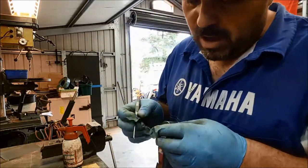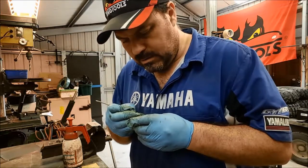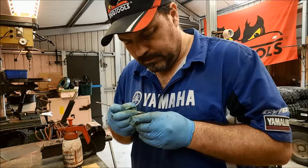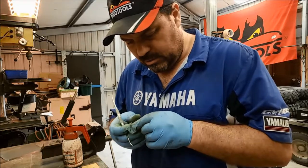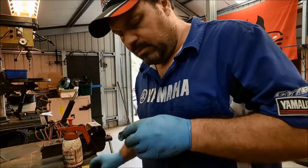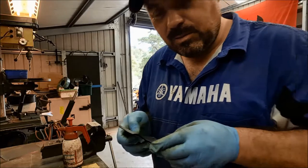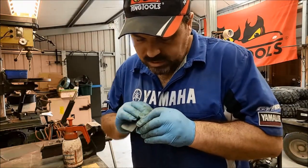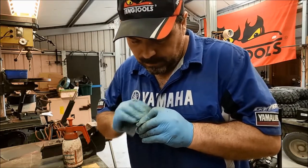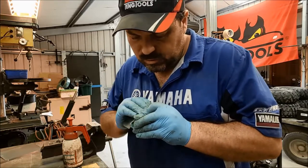I'm just trying to determine whether these marks are a build-up on top of the surface of the piston, or whether they're actually wear, you know, erosion into the plastic. I think it's erosion into the plastic, to be honest. So there really is a limit to how much I can sand away at that before I'm going to start to cause problems with the overall dimensions of the piston and cause the main seal to leak. But it needs to be smooth. If it's not smooth, it should be replaced, you know.